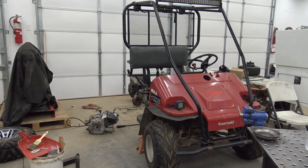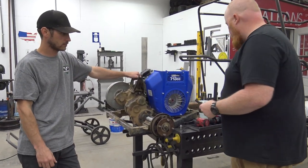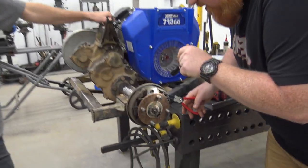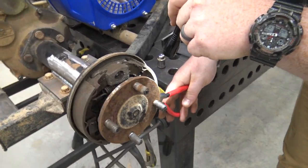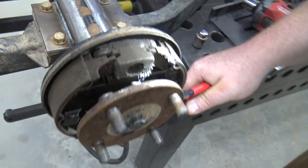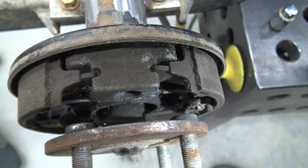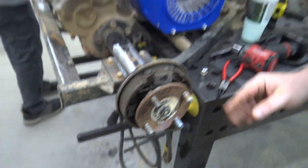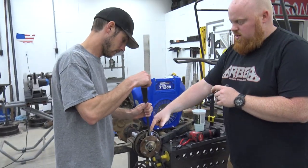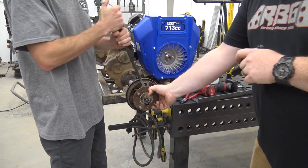What we're going to do is pull one axle out. The only way to get these axles off is to pull off the drum. You've got to have good clip pliers — there's a clip behind there that's kind of a pain to get to. Once you get that clip off, you can pry the axle out. It's probably a good time to do axle bearings, but I don't have any. This is pretty much your wheel cylinder, but it's all mechanical.